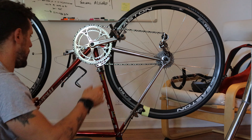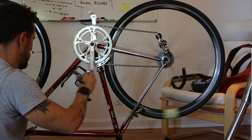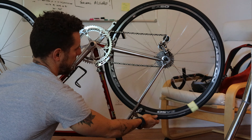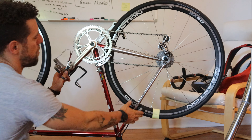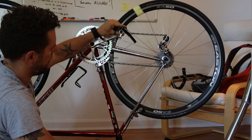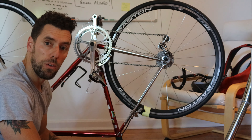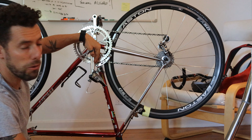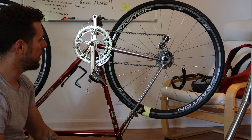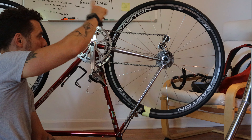So if I now change the gears — putting it on the bigger cog and the smaller plate — this is the gear you'd use for a big climb. If you track the wheel, for one full revolution there, I had to go half a revolution on the pedals. So with the other gear, just a quarter-turn moved the wheel one full revolution. With this climbing gear, I have to go half a revolution.